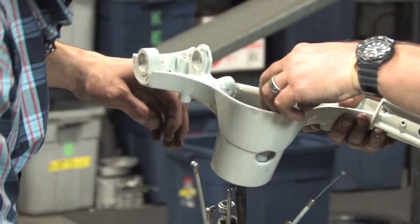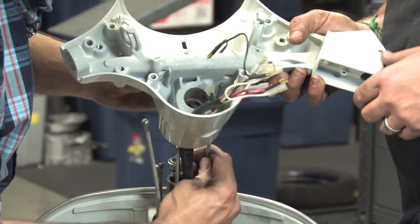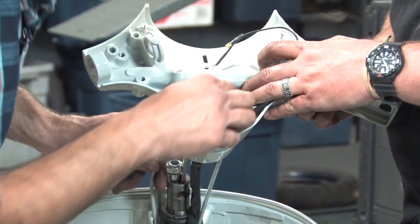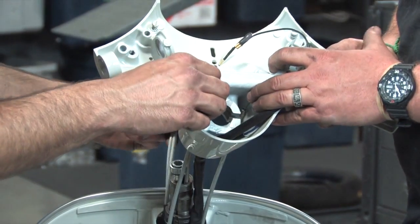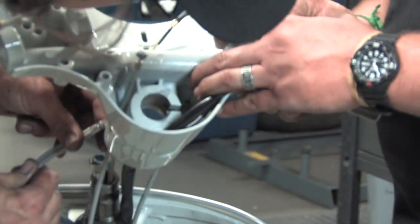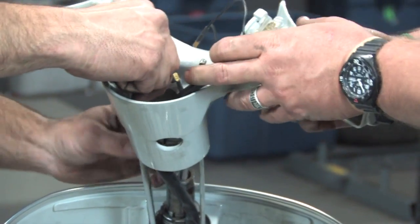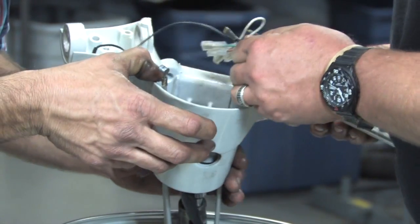You can see where I'm putting the wires — they actually go beside that bolt area. There's the throttle cable going to pop through this hole a little later. Here's our clutch cable — it goes on that side. Then there are our two shift cables. Go ahead and pull these up just in front of the actual clutch cable. The ones coming through the center of the fork are pulled down so they're kind of out of the way.